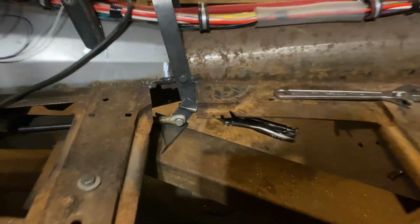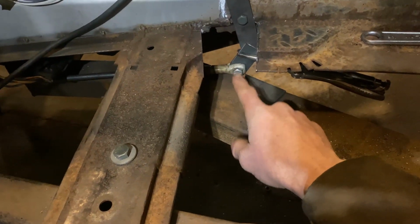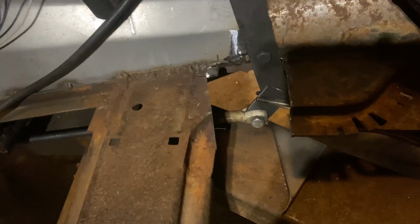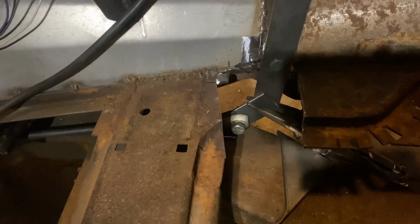So that's a super quick mock-up. You can tell by the vice grips in there. Let me just move that shim under there. So I just had to re-bend the adjuster linkage, and I just put an angle bracket connected to the hoop there. But if I pull on this, let's see if I can do this with one hand on the camera. Should, hopefully. Yeah. So park, reverse, neutral, drive.